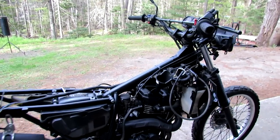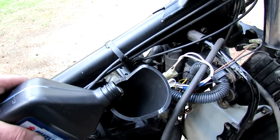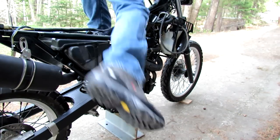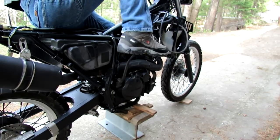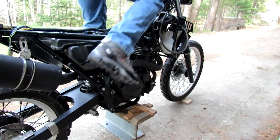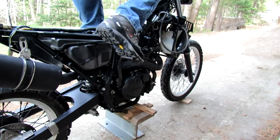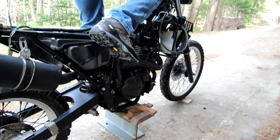One of the things I did in preparation for starting the engine was to add some engine oil to the cylinder sleeve. I poured a little bit of engine oil through the spark plug hole. After adding oil to the cylinder, I decided to gently turn the engine over using the kick start, with no spark or starter motor, to gradually work oil through the gears and through the piston as an added safety measure.